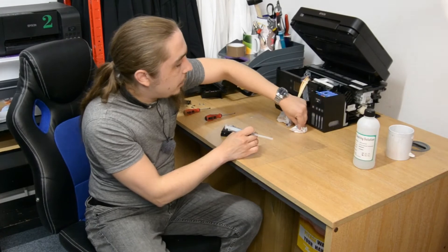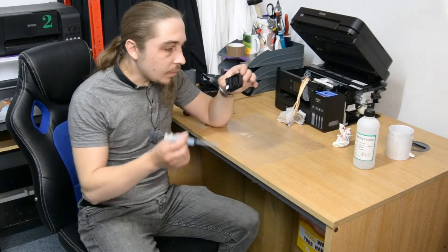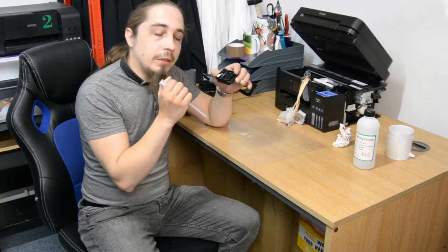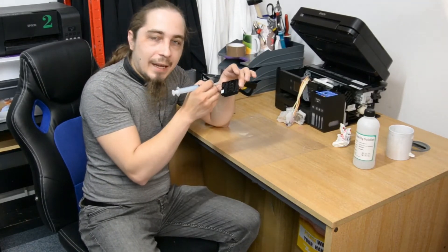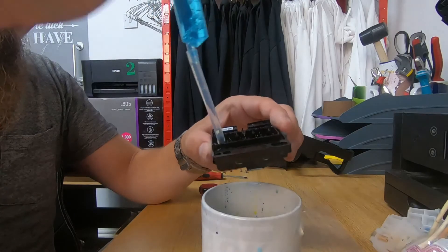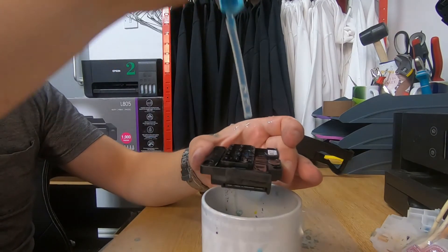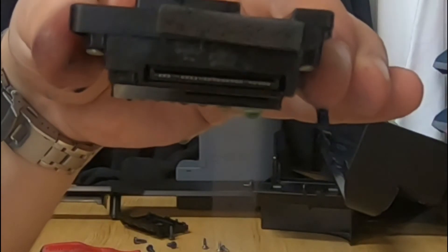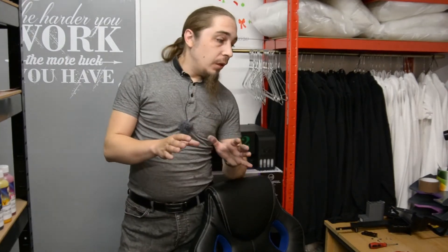I've already managed to make a mess on the desk — very nice. What you are looking at to see whether your printhead is damaged or being cleaned: when applying pressure, you must see that from underneath, the channel being used at the time is dispensing a nice, even line. Once you've checked that all channels are running smoothly with no issues, that's how you know your printhead is good.